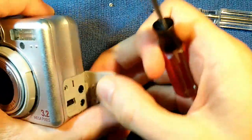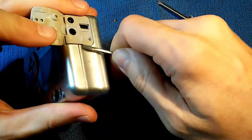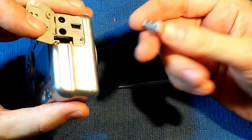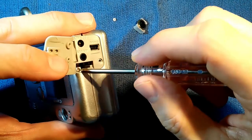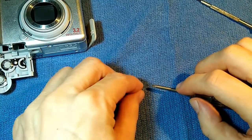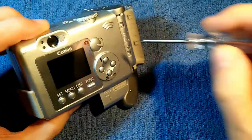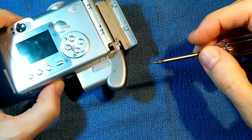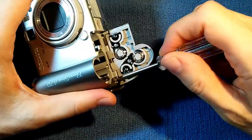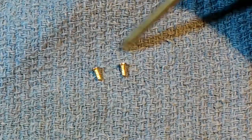There's a little plastic cover that we pry open with a flat-head screwdriver — it holds a little CR1220 battery. Underneath that cover, there's another screw: a six-millimeter long coarse thread screw. Underneath the memory card cover, there's another screw — a two-millimeter fine thread screw. Going back to the bottom of the camera, we have two more screws. Those are coarse thread and four millimeters long, anchored into plastic.